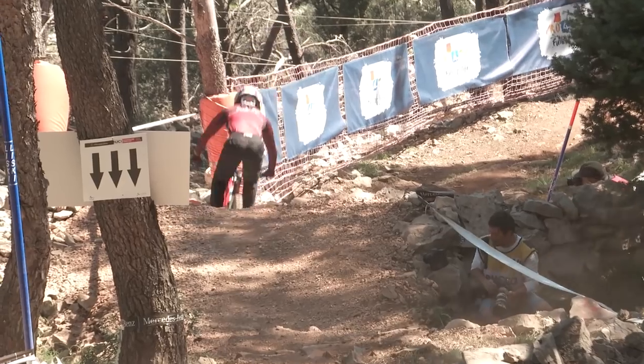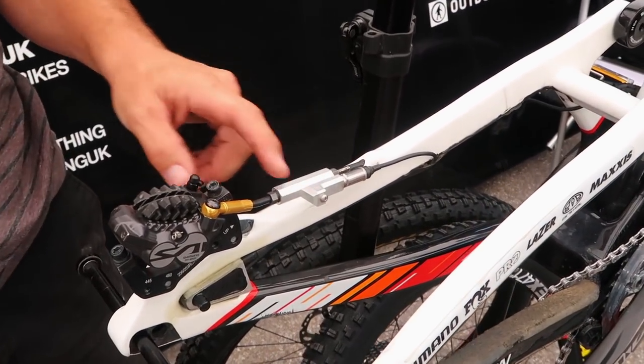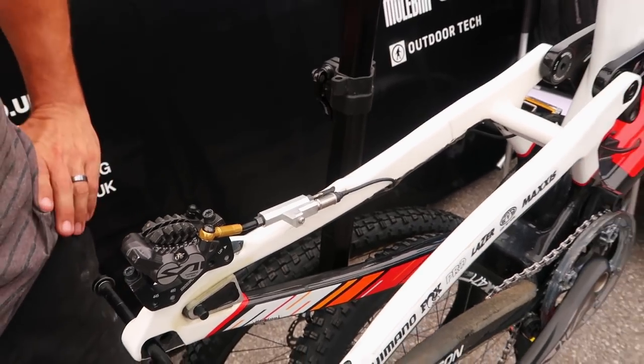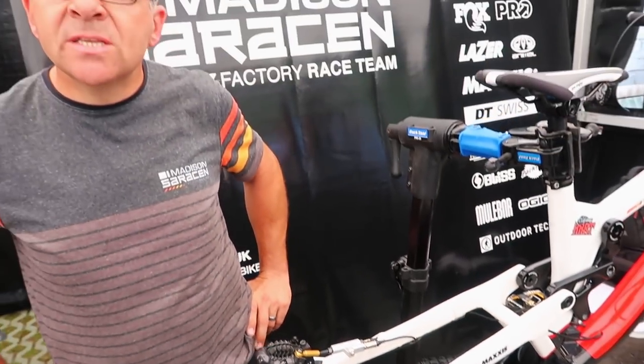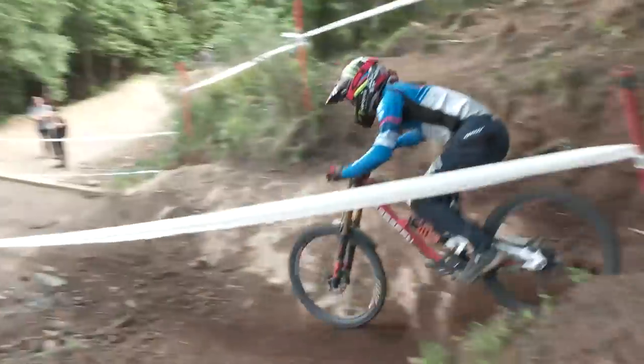So the first thing you can notice is the brake pressure sensors front and rear. They basically measure how much pressure in bar that Danny's using the brakes. So we can tell if he's dragging the brakes unnecessarily through any sections that he shouldn't be on the brakes. It also gives us an indication if you've got any brake rub due to some slight flex, because everything's got flex out there, but there's an acceptable amount that you can cross off the list.